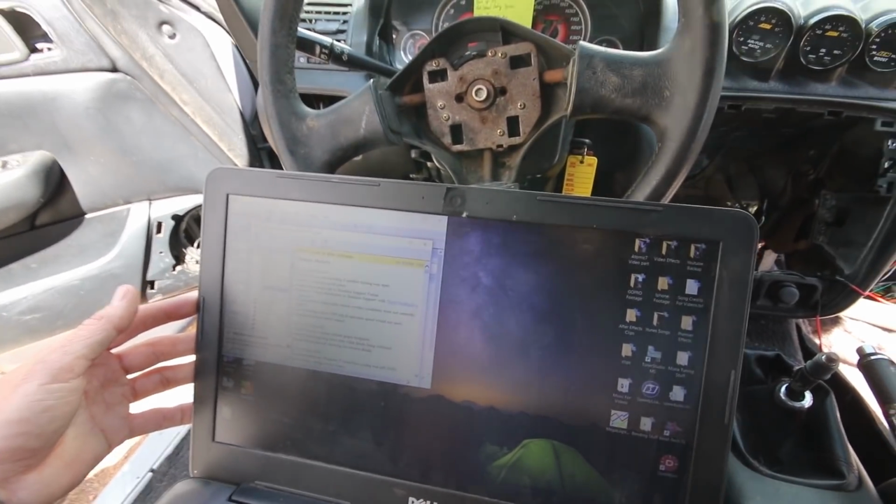Okay, well, we're in. I don't know if I did this right. It was telling me that it needs to be registered, so I'm assuming this is a fresh install. So I had to download the S300, like I said, but it let me view the tune that was on there, so I was able to get to the injector settings, and I changed the settings to 1150 cc's instead of the 220s that were in there, and I changed the dead times to what Grams has on their website for just the idle stuff, the base, whatever you call it.